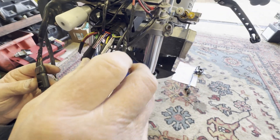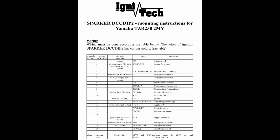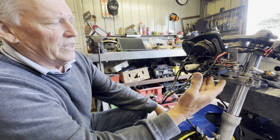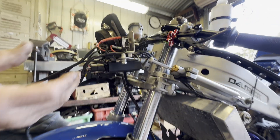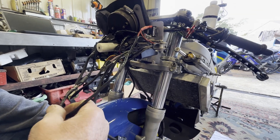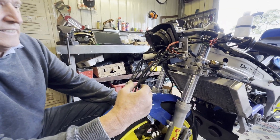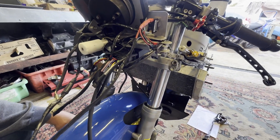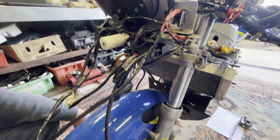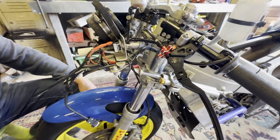Our difficulty was finding out what colors went where - there's not many of these units been fitted to model bikes like this. We went searching on the internet to find basic coloring for what Ignitech have done previously on models like RZs and TZR road bikes. Most of these ignitions have been set up for four-stroke road bikes, so having it set up for two-stroke shouldn't really be that difficult providing you know where everything goes. We've been able to make the tacho work correctly and the power valve to work correctly.